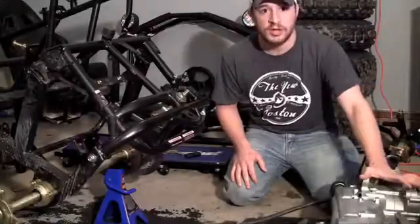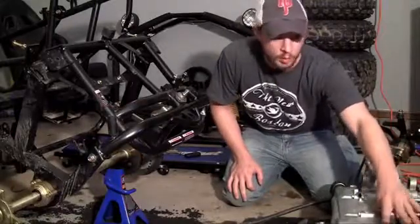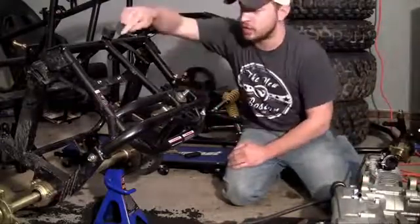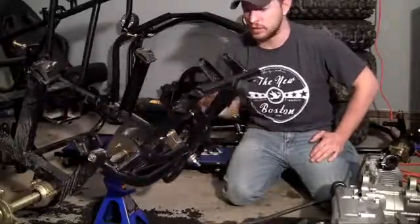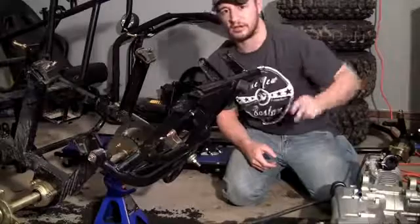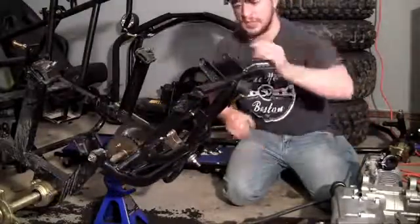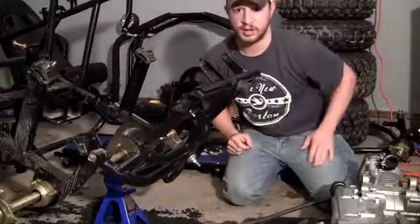Like I said before, this engine is built to mount onto your frame in two locations: one using a bolt on top and the other using a bolt on the bottom. Now whenever you build your own custom frame, you would want to first measure these two little locations right here and weld brackets onto your frame specifically to fit this engine. But this frame, like I said, I already bought pre-welded, so it was already built specifically for this engine. If we just plop it in there, there are already brackets in here to fit it. The only thing we need to do now is, as you can see, the back of this frame pivots right here. So we actually put this engine in upside down. Then when we pivot or rotate it back, the engine is going to be right side up. So let me go ahead and show you guys how to do that right now.